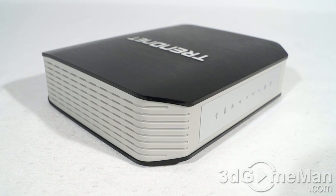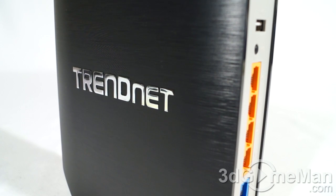Also firewall protection with NAT, or network address translation, wireless distribution system or WDS support for wireless network bridging, advanced wireless security up to WPA2 RADIUS, so you've got some really good security there. Also WMM, or Wi-Fi Multimedia, and configurable WAN quality of service, or QoS, support. This router also has guest network setup, 3 per wireless band, with internet access restriction. This is excellent because when you have your friends and family over, you can quickly and easily set up a guest network.